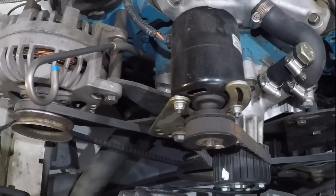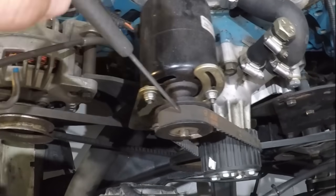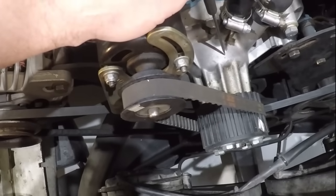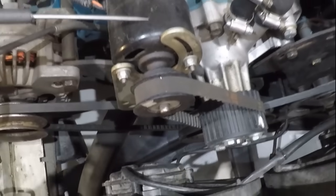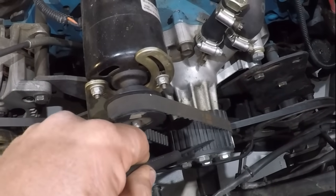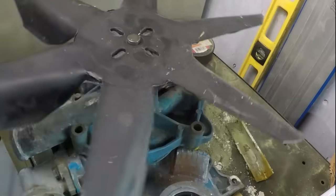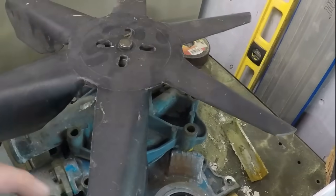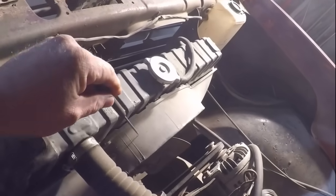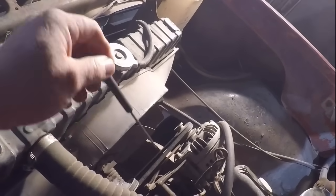Here's an example of a belt-driven electric water pump. You have the electric motor here, it drives a belt, the belt turns the water pump — so there's no drive from the crankshaft to the water pump. The electric motor does all the work and keeps the coolant circulating. There are provisions here — you can see the belt drive is hooked up. You can buy one of these plastic fans and bolt it on there, and when the electric motor drives the belt and drives the water pump, it drives the fan as well. I highly recommend that you keep the shroud on so that the fan works the same way with the plastic fan driven by the electric motor instead of the crankshaft.